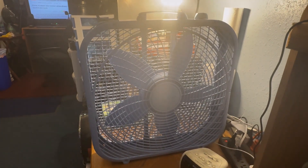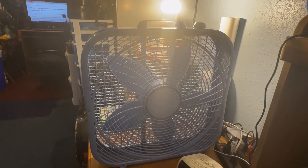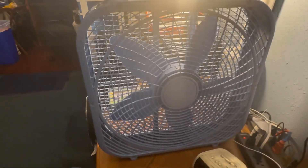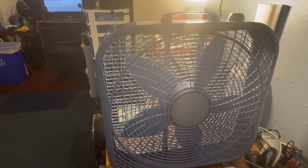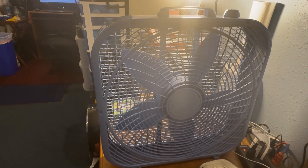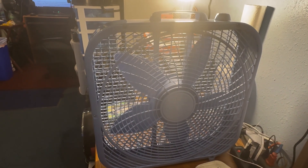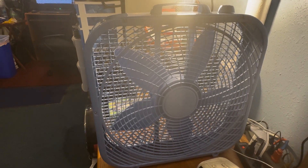Brand new fan out the box, just got it today from Walmart — they delivered it. The motor is sort of weak because they're using these new weaker capacitors, and it has a square motor. The blade is absolutely 100% terribly out of balance. Even though I have the feet on here, it still scoots across the table when I try to run it on high speed. Given that it's not all that powerful on high speed — more like medium. This was made the fifth month of 2023. The blade on this particular one is absolutely deplorable, abysmal, out of balance — it's shaking all over the place and scooting all over the table.